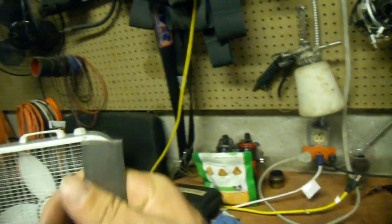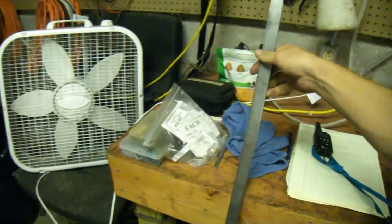So I just have this 3/4 inch flat stock, and basically I'm just going to cut little sections, bend it, make little brackets, and then bolt it through the tunnel. And it might be a pain for me to bolt it through the tunnel from the bottom. So I have some somewhat large, big self-tapping screws, and I may just put those in there. We'll see if I decide to be that hacker-esque. Oh, excuse me. But that's my plan. So I'll show you what it looks like when it's done, and I'm ready to paint it.